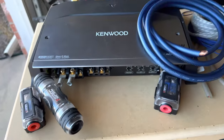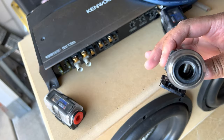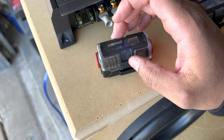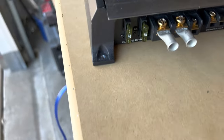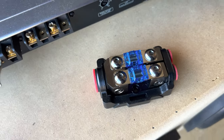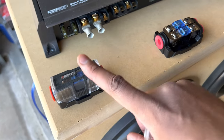This is everything I need to install. Someone reached out and asked if I could do a video on the wiring — it's pretty simple but I'll go over it. This one is for the Monte Carlo, this is a one-hot cable. What I'm running is four-gauge oxygen-free cable. This one goes under the hood — it's a mini ANL fuse holder with a 60-amp fuse, because the amp itself has two 30-amp fuses. This is basically a distribution block. I was initially going to run an amp to my highs — run one four-gauge in and two four-gauge out, one to each amp.